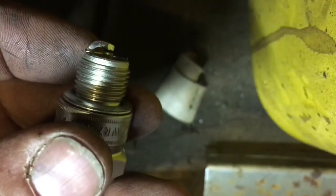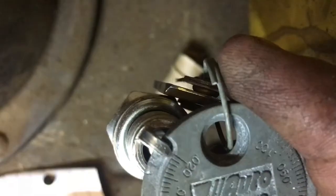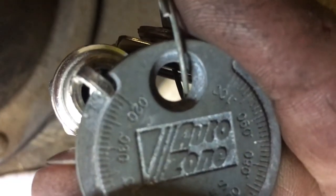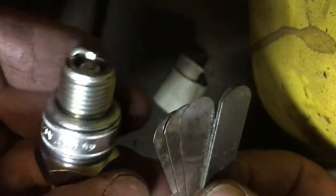The box comes wrapped like this — pull the paper off. Now let's see what we're at. Right off, I can barely get it in there, so that's more like 20–21 thousandths. You want to check your car, check your owner's manual, or depending on how your engine is built, your engine builder will have told you what to set them at. They're not necessarily correct right out of the box. I also kept feeler gauges around when we had to deal with this sort of thing. If you were setting the point gap on a distributor or setting the gap on your plugs — a common thing with standard ignitions — then you kept some of this stuff around.